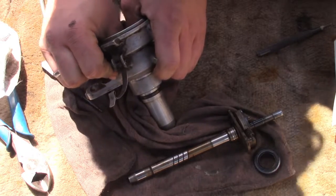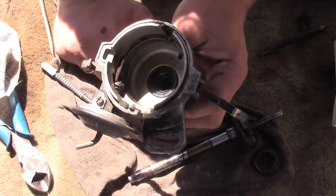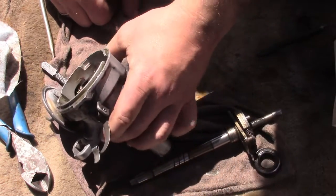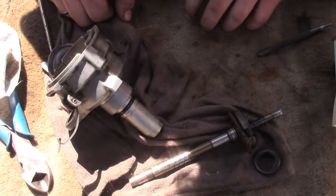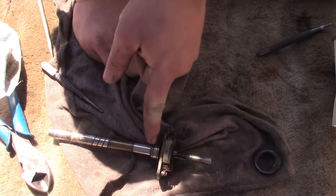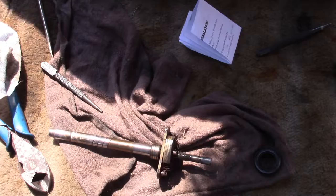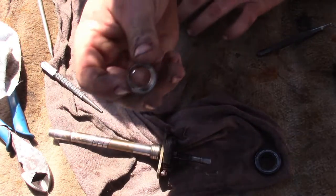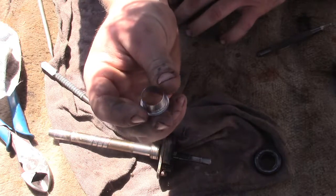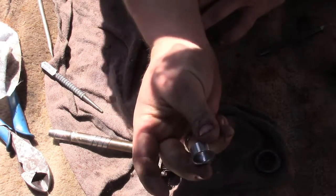If you're well oiled, you should be able to push that seal in with a firm thumb - it shouldn't fall in, but well lubricated it should slide in fairly easily. Now the more interesting part is getting our repair sleeve on the distributor shaft. Obviously the sleeve has to go here. This is an SKF 99068. It is ever so slightly taller than what it needs to be, but you can very lightly trim it down. It's for a 17 millimeter shaft, it's about 10 millimeters tall, but you only need it to be 7 or 8 millimeters tall - this is the closest thing I could find.